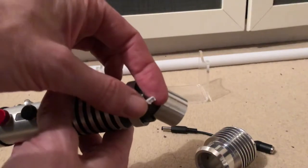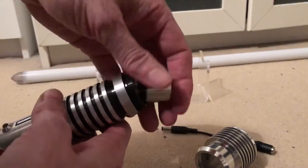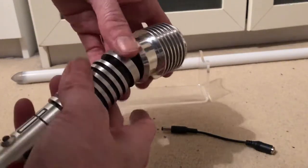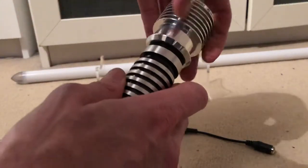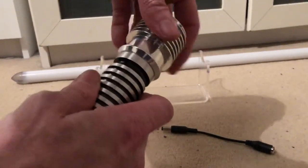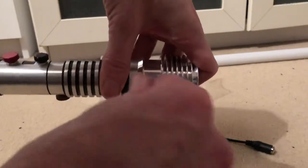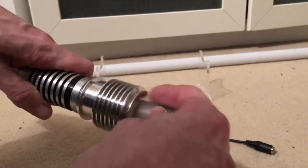So this is your micro USB port, and just up there is the SD card slot. Just pop that back on, push your heat sink so it's in place, and then use the right Allen key, put that back in, and hold it nice and tight.